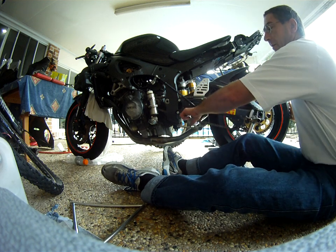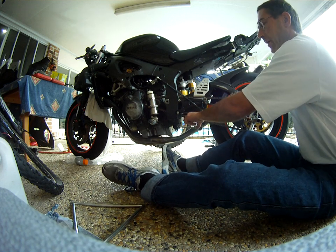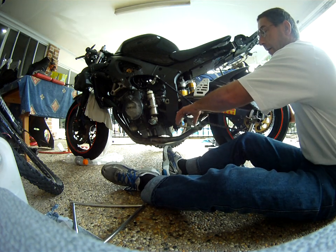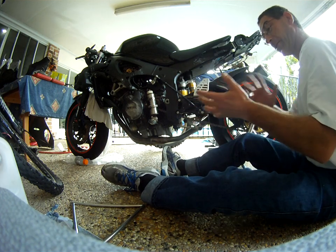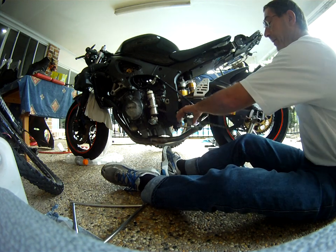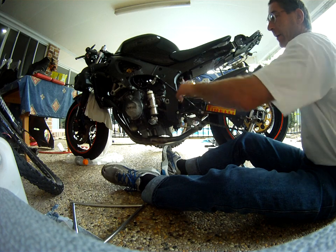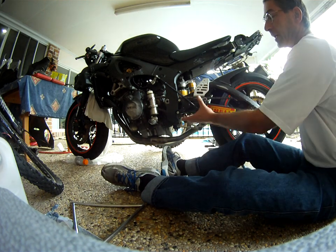Let's come back down our gears. We slow down, take the clutch — there's no drive through the gearbox, it can go down into the next gear. We preload again, it goes down another gear. Hear it click into gear. It was between gears for a moment — we rotated the gears a little bit and it slid in and met its next gear. Watch that again — see the two stages: one to release the last gear and then the next to slide the next gear into place. And we're back in first gear.